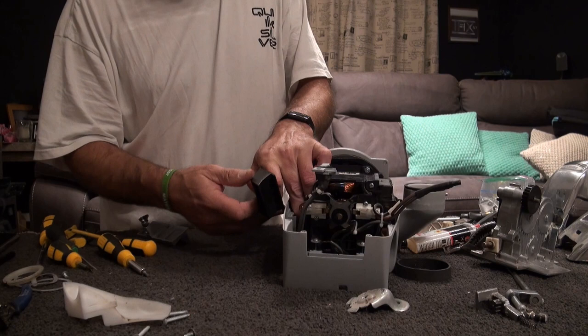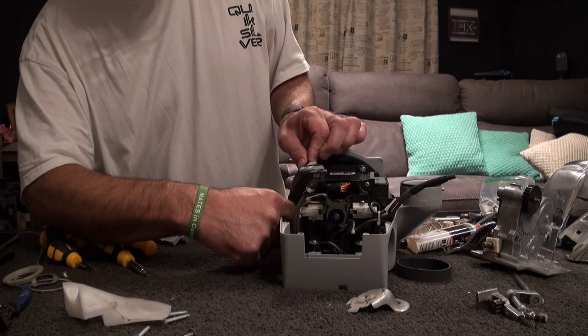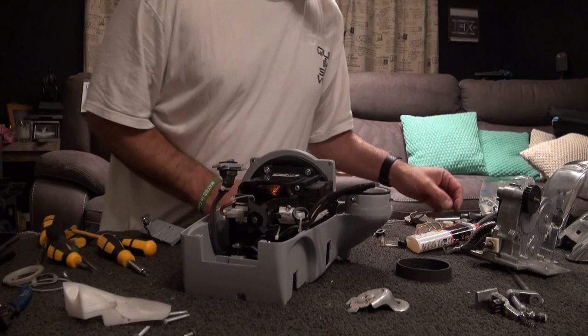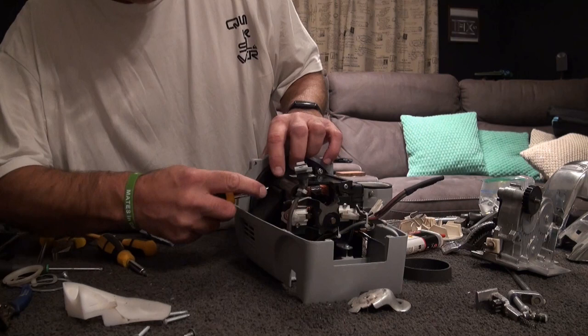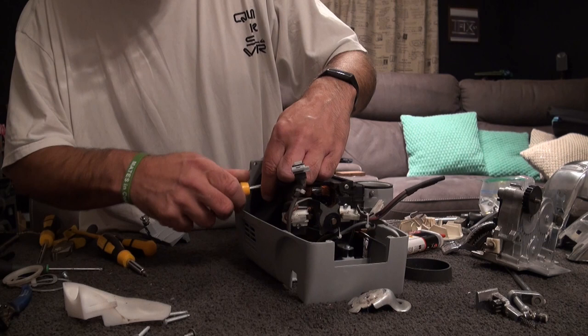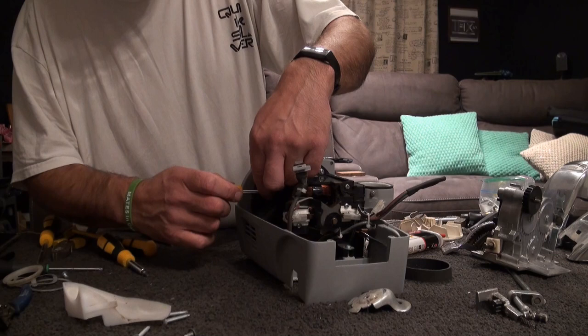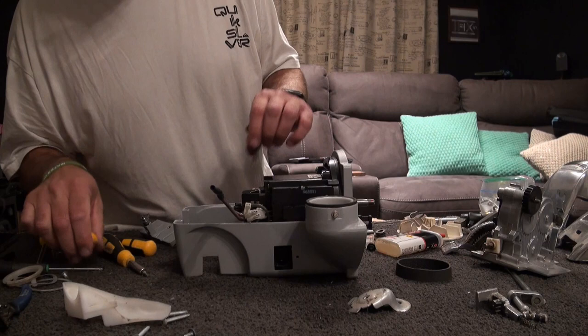Okay, then we get our exhaust fan. Now remembering there's a little Phillips screw, so this is a pain. There they are, sorry. Okay, so that just slots in, screw side at the top, slot that in the exhaust hole, and that will hold that in place. Alright, so we've got a little tiny Phillips screw, which goes in the top, just to hold it in situ. Okay, take your fingers, push it in, just down, damn it, doesn't pay to have big hands. Okay, we just tighten that up, that's that bit there. Okay, so that's that.